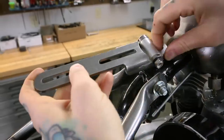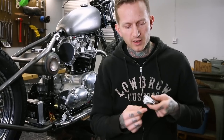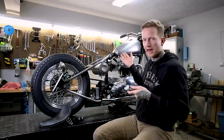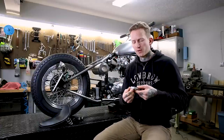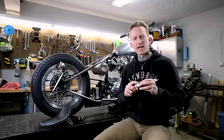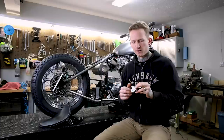It engages to the stock rear tank mount. The nice thing is this will actually work with your stock Triumph gas tank — it'll slip right on top of the gas tank mounting tab and bolt through both. Or it can be used where we're going to have a custom gas tank on the bike. This pivot is aluminum. We also offer the same pivot with a black body, and we have both bolt-on and coped weld-on versions — basically a seat pivot for every type of bike.